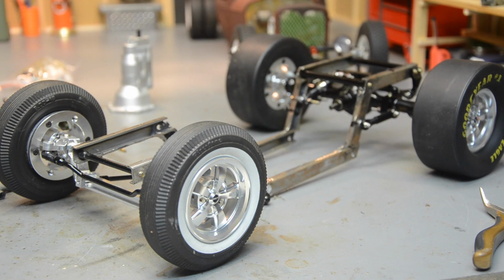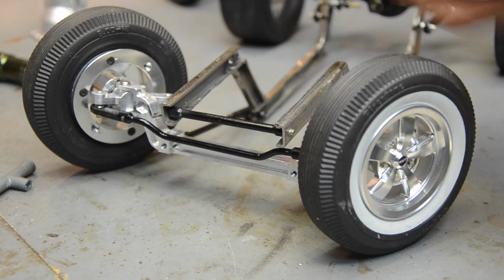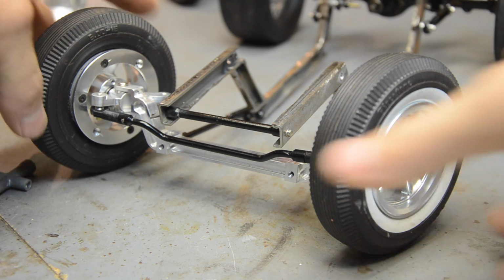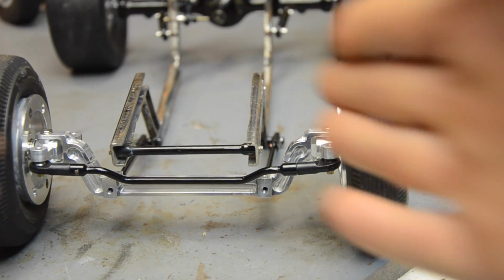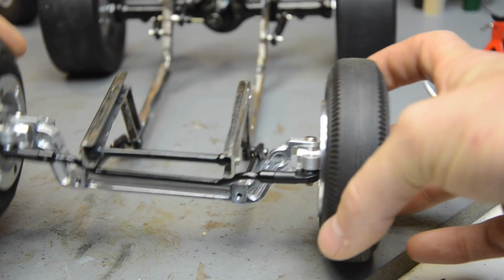It's nothing fancy. We've got our standard radius arms. You can see the other side there. They are 73s, I think, or 70mm with 2 spacers, 1 on each end, and then the long offset rod end. And I did put some spacers on the frame back there to kind of pry them out, and that helps stiffen it up so we don't really get a whole lot of side-to-side travel. We're getting it all from the rear.